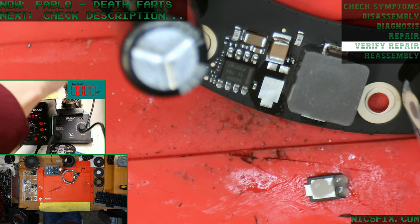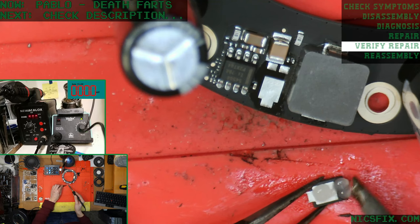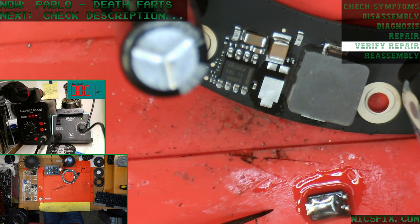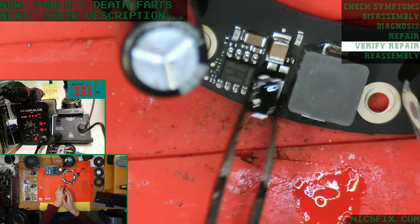I wonder if one of the reasons maybe why Apple may not have done a recall for the no power issue is because maybe they just don't know which HomePods were assembled with those bad diodes. Because not all first generation HomePods have the bad diodes. Some of them have diodes with date codes far outside of the range that we think is that bad batch of them.